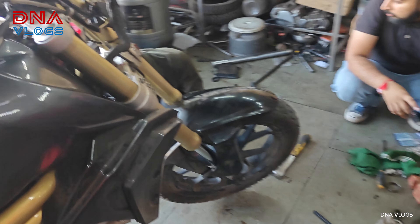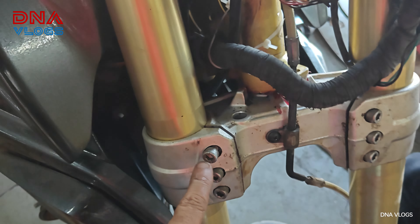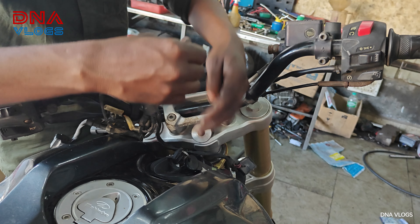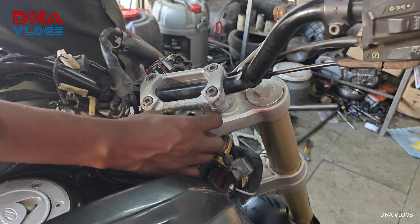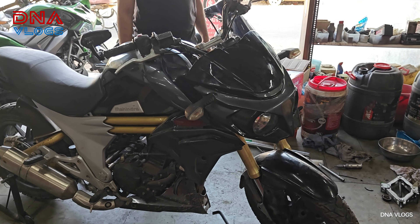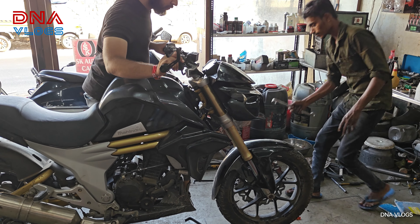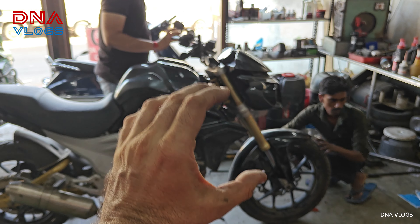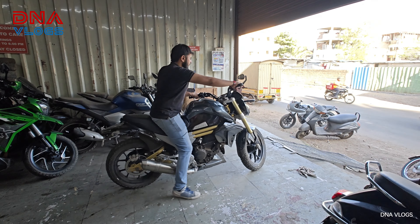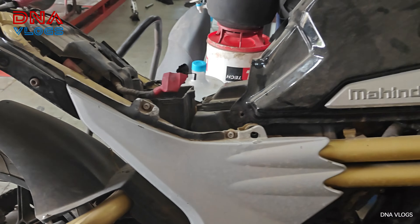The wheel has gone inside, brakes and calipers are being assembled, and the fork is almost done — just tightening all the bolts. All front bolts are tightened, the main T bolt is assembled, and the headlight with all wiring has been reassembled. We'll take the bike out for a test ride. After 100–200 kilometers, we'll have to come back and tighten the fork again, as the bearings will settle and may become slightly loose.